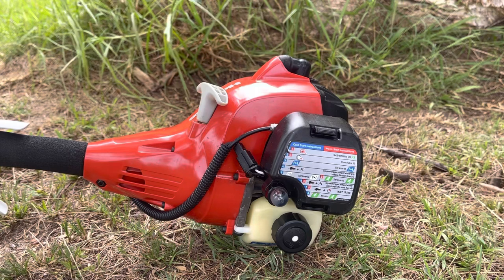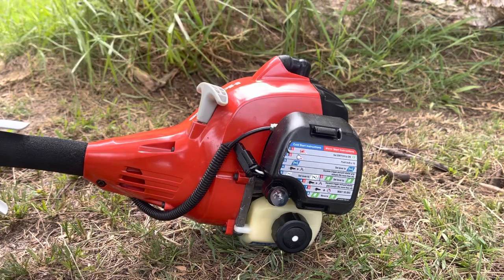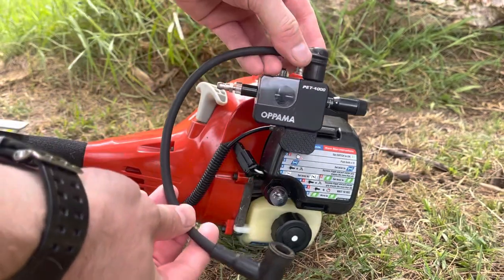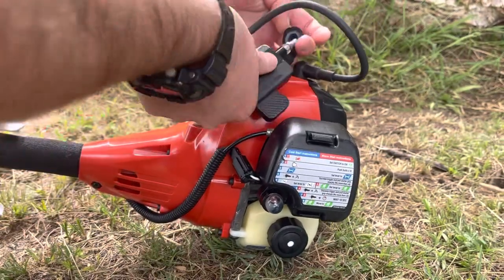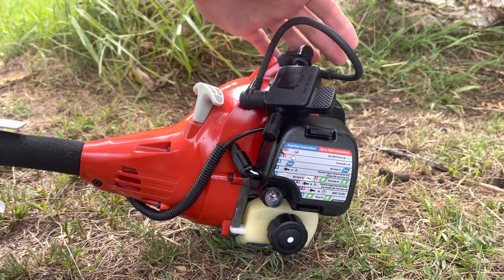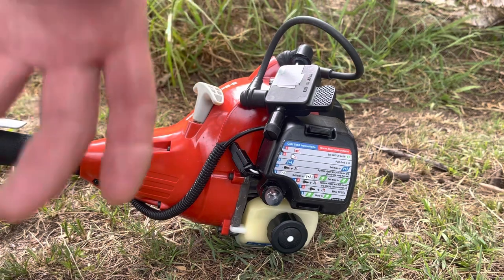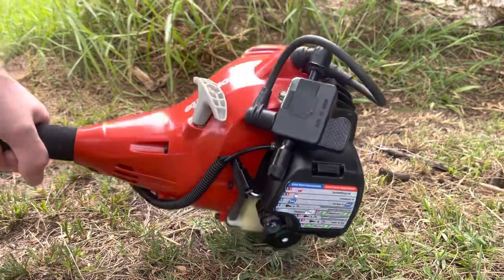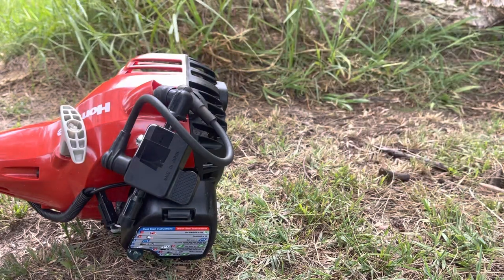So what do you do in an instance like this when you're trying to get a reading? Well, the only way I've found to get a reliable reading is pop the boot off, get yourself an inline spark tester - it doesn't have to be this one, this just happens to be an Oppama. Plug that on, connect yourself in place, start the machine up and then use this wire to get your reading. You will get about a foot of inductive reading from that cable. If you haven't got an inductive tachometer, you can just clip your lead to that wire and you'll get a perfect reading. Let me tilt that forward so you can see - I'll hold the tach over here and you'll see it still gives a fantastic reading.